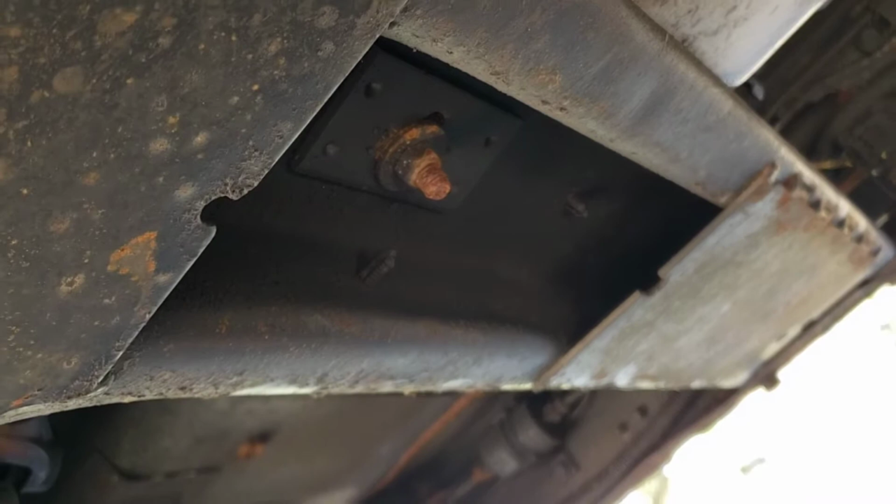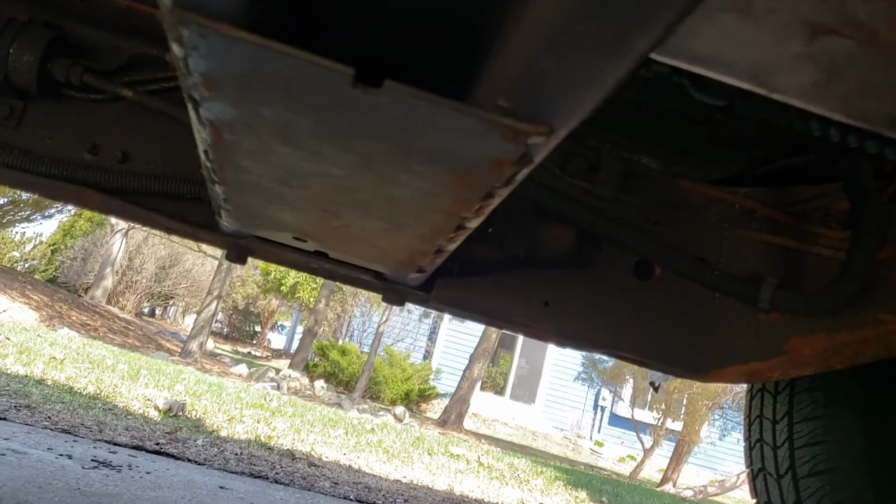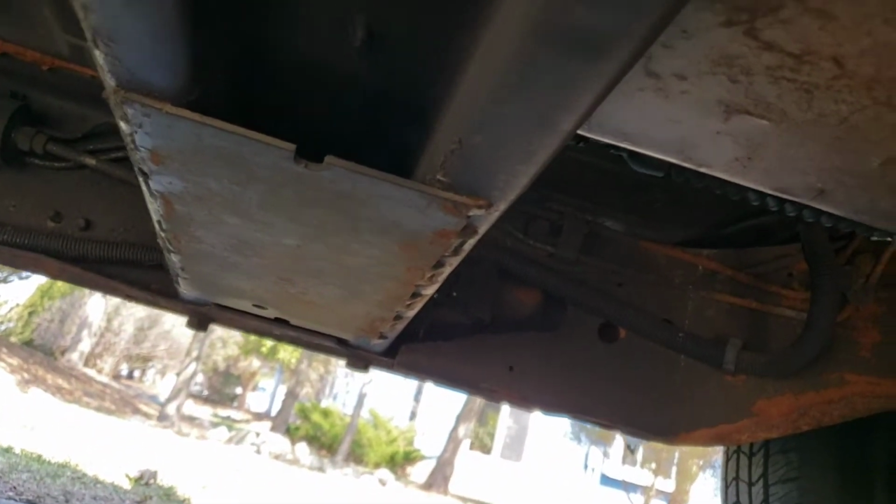It's 14 millimeter right there. Not exactly sure how big these sons of guns are. You got to pull these on both sides. Over there. And over there. Now, you got to pull that all out just to get to the transmission bolts. Right there. See the back of the pan? The other ones are easy. Normal cars, just grab them and pull them off.